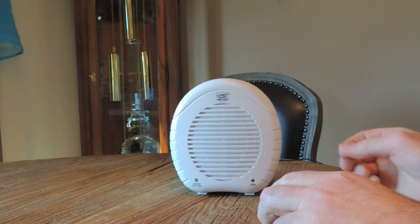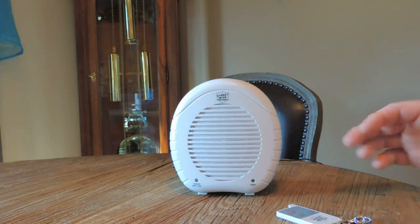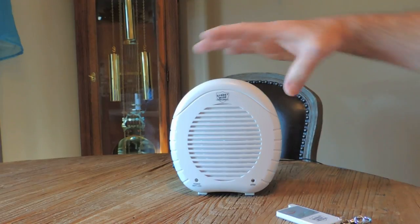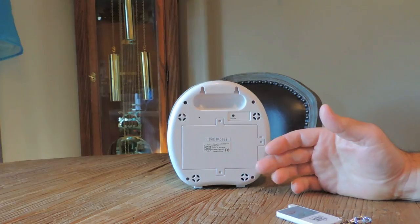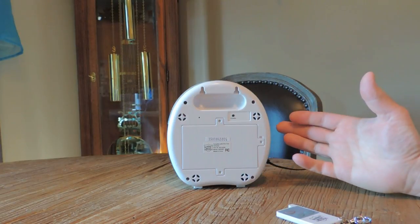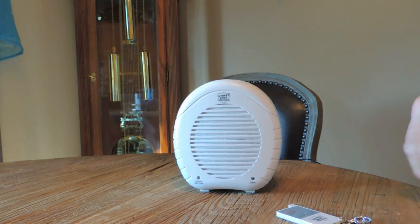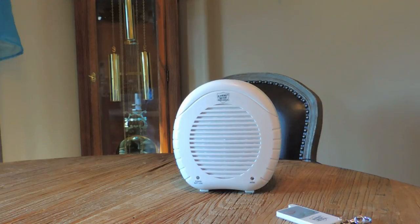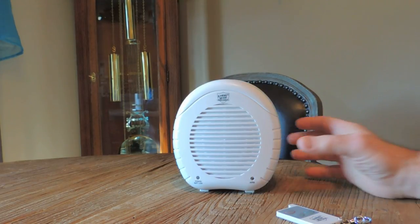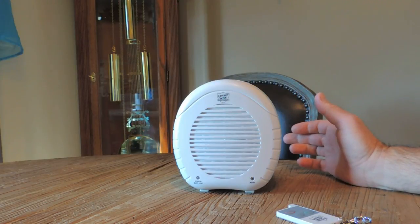So the way the unit works is it actually detects through microwaves all the way around the unit. Your largest detection area comes from the actual back of the unit, where it can go out as far as 15 feet. The sides and the front are 5 to 10 feet of a radius of where it actually detects. So in an open area, it has its greatest detection area, where if you put it back up against a wall, it goes out around 5 to 5.5 yards, I believe.